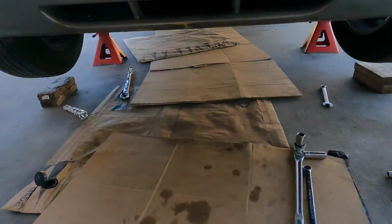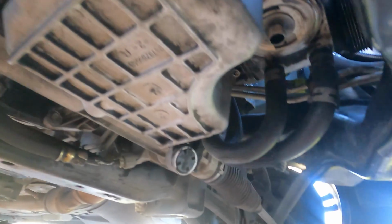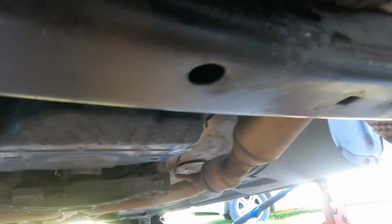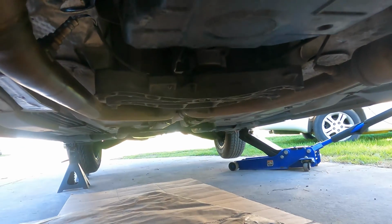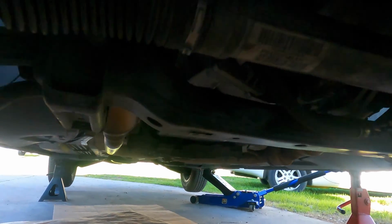Whew. Well, I'm done underneath finally. I got the torque converter bolts tightened. I've got the oil pan on, the rack and pinion in, the exhaust buttoned up. Nope, I didn't do the two rear bolts where the Y comes together. Almost done underneath, but I mean, it's looking good under here. I just have to go back and do those two bolts way back there where they come together, those pinch bolts. Then I can let the car down. No, I almost forgot again.